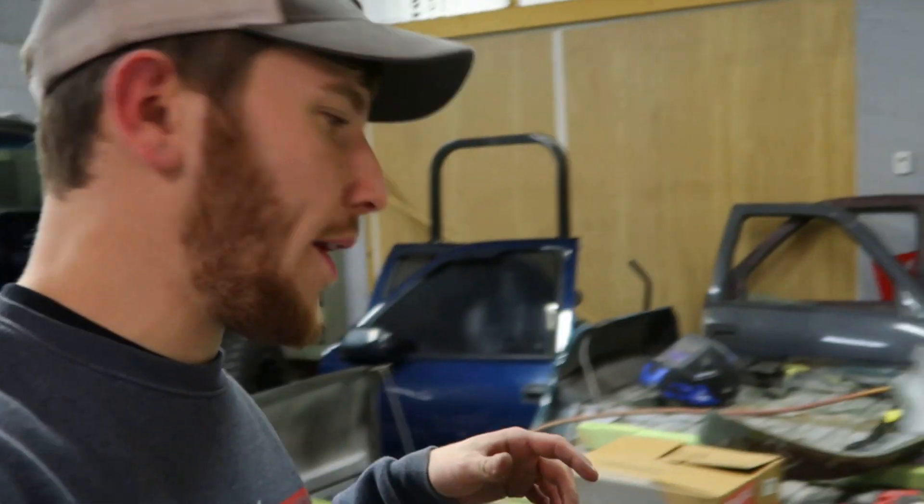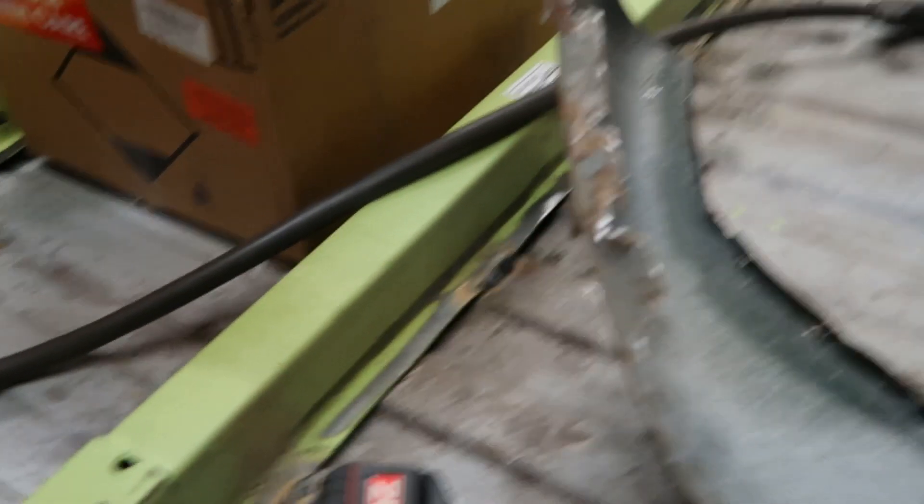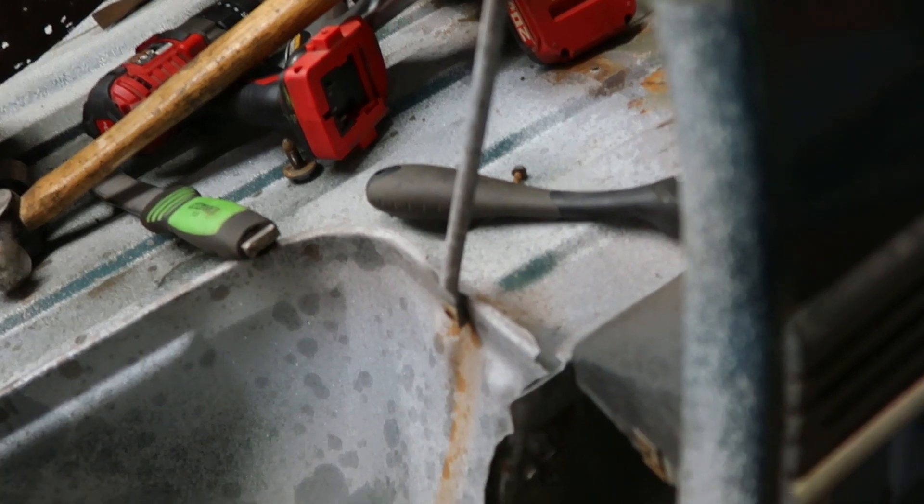Hopefully you guys can tell I got that part removed. What I ended up doing was taking vice grips and bending the flap up on both sides — it only needed to be like that at the corner parts. Then I took the air hammer and broke all those spot welds across there. I'm going to take the grinder in there and clean all those up smooth. It's got some surface rust in there, a little bit here and there, but not too bad. I'm going to go ahead and get this all sanded down and throw some primer on it before putting that new panel in.